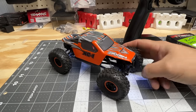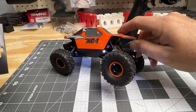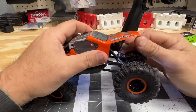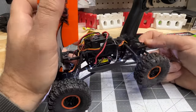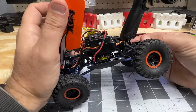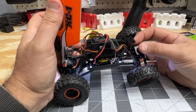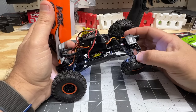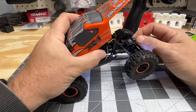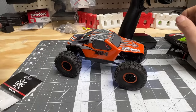I think one of the biggest upgrades that's going to be crucial is that if you put all that weight on it, those servos are not going to handle the weight wanting to turn. This is a different style of servo mount, so we'd probably need to raise the servos up a little because of the way the links flex. If we cut away some of this and mount longer servos on top of that link, I'm wondering if the flex will cause any problem. But looking at how it flexes, I think it's actually fine. So we could do some servo upgrades if the weights are a problem as we're comping this out.